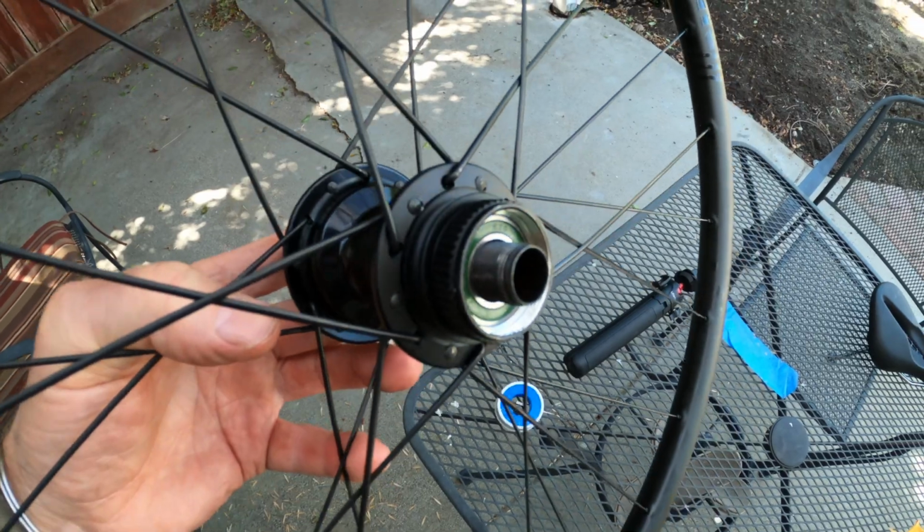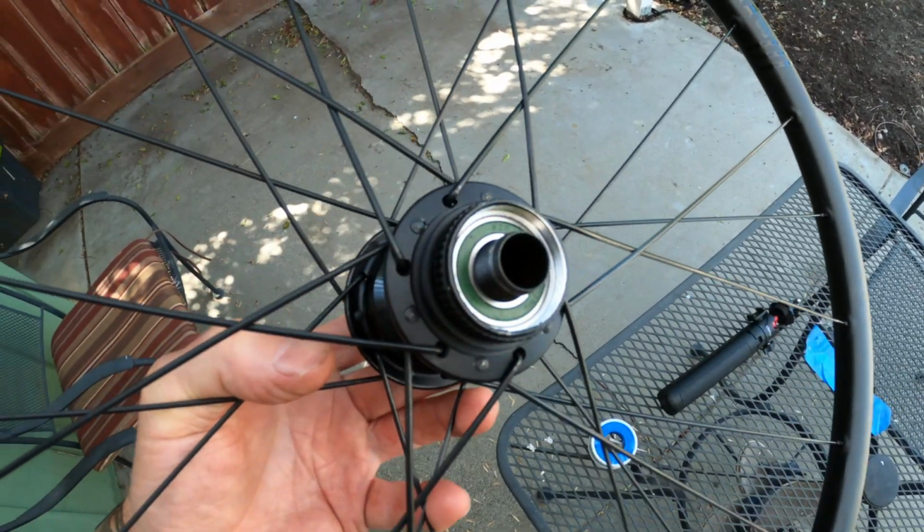So I had to hold that small aluminum threaded axle with something and break the other side loose to get it out, because now I've got the wrong side axle cap off. Well, they tell you to clamp that in an axle vise, but a soft-jawed aluminum axle vise is fine when we all had steel axles like Shimano used for years with their cup and cone. You can't hurt those with an aluminum vise. But this axle is aluminum, and there's no guarantee it's harder than the vise, and it was paper thin, the end of that axle, and there's very few threads to actually grab.